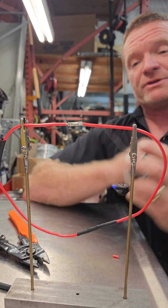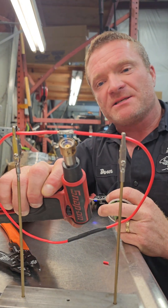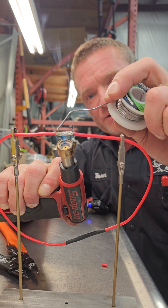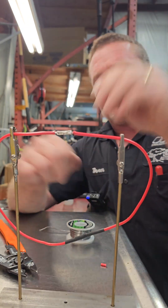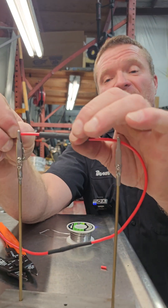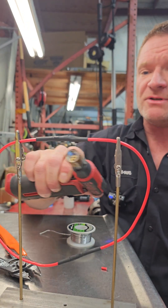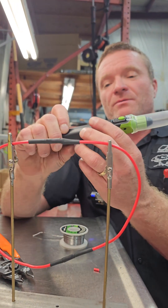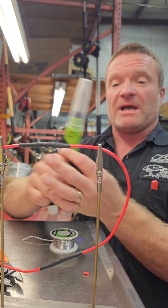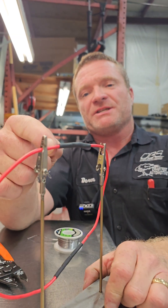Now I'm going to put some solder to this guy. We're using a rosin core solder - it has flux already in it. Really simple. I'm going to use the torch on this one just because it speeds up the process. I'm going to heat this connector up and you're going to start seeing it kind of turn a little bit. I'm going to slide that guy over, make sure I got it even on both sides, and take my torch and give it a little bit of love. You can use the heat gun on this - you don't have to use a torch. Matco actually sells these really cool electric ones that have a little coil you can use to heat it up as well, that way you're not having an open flame. Really simple, not that complicated. Doesn't take a lot of solder - I just give it enough that it draws the solder in and makes the connection. This actually has a gel in it, so it seals it.